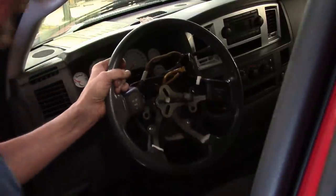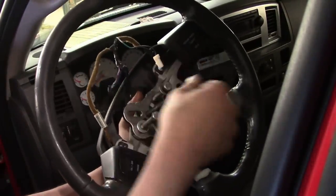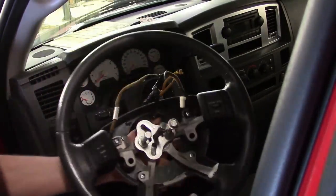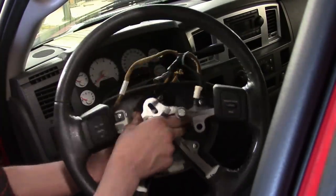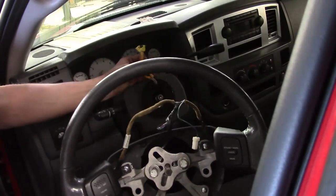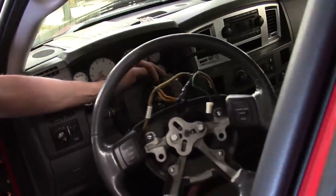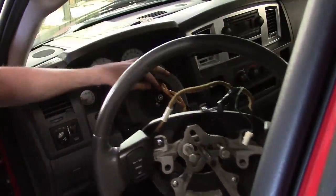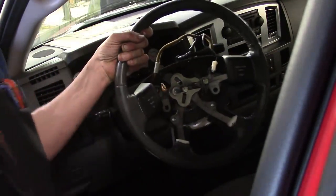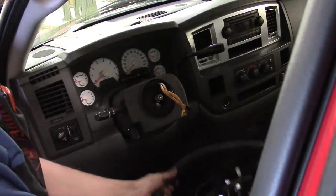The steering wheel is now off. Remove the puller bolts and set them aside. You can now replace the steering wheel or access the clock spring. Keep in mind this is a keyed steering wheel — it can only go on one way without excessive force. Keep the orange or yellowish wires routed up at the 12 o'clock position. Line up the keyway on the steering column and steering wheel, slide it down, get your 13 millimeter bolt, tighten it down firmly, then reinstall your airbag assembly and reconnect the battery.